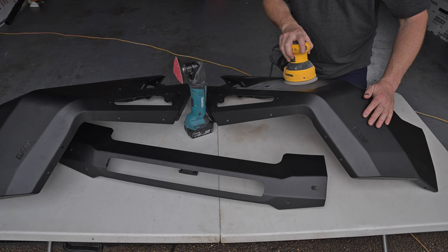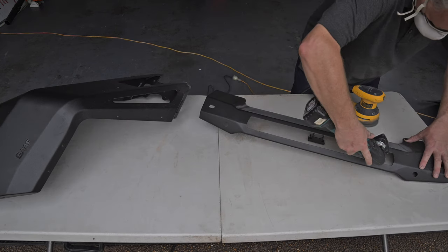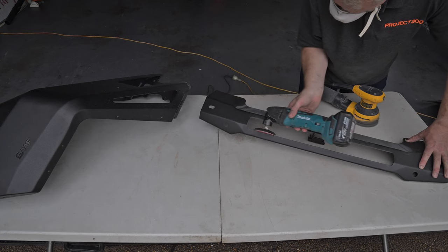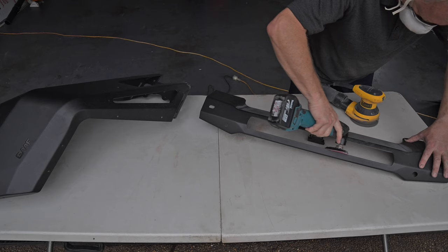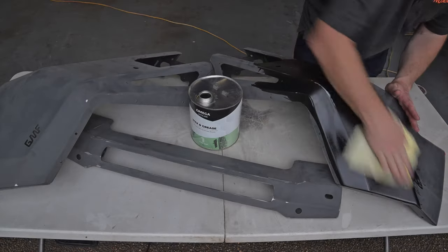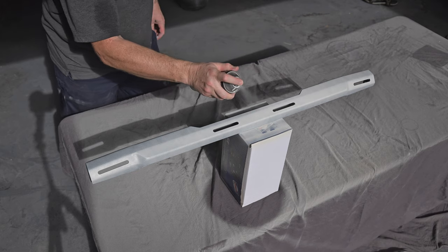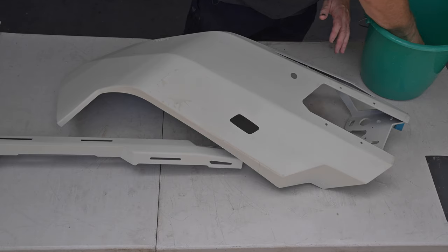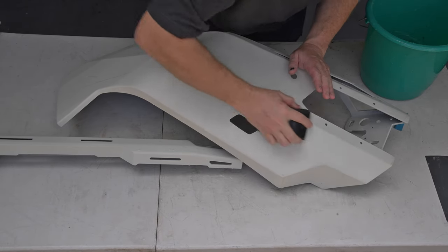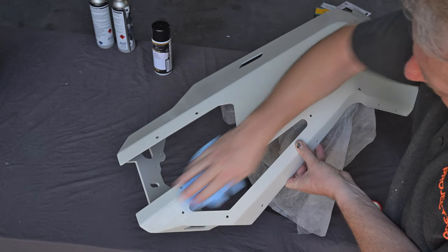Before you can paint the bar you'll need to sand the powder coat smooth using 240 grit paper. Four components need to be painted: both wings, the top trim and the bottom trim. I'm leaving the main centre section and all the grill work in powder coat. After sanding, clean the components with wax and grease remover then apply two coats of suitable automotive acrylic primer. After the primer is dried, rub back lightly with some 1200 wet and dry to get a smooth surface, then wipe over again with wax and grease remover.